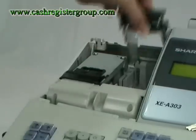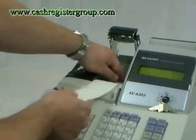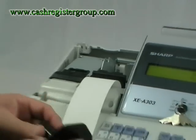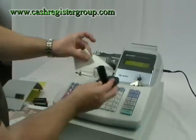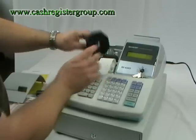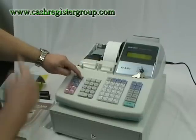On the other side lift up, get the till roll like this, push down. Get the till roll and the spool, fold it over and put it into the side of the machine here — you can see it's there. Place it on here and press the journal feed and it should take it up and go round inside.